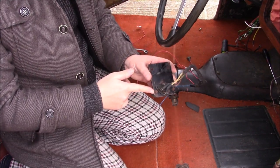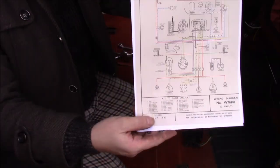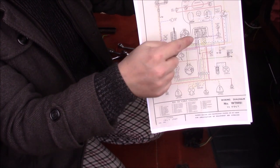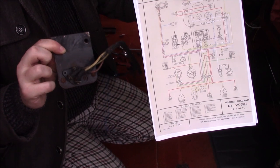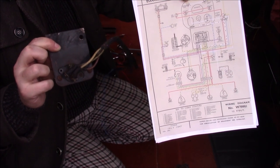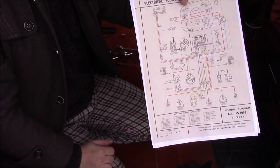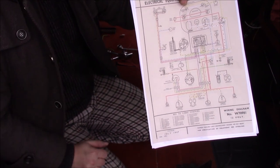To do the wiring on this piece I'm going to disconnect these one at a time. I know from the wiring diagram that it's this switch here, and the wiring colours on here do match the wiring on here — this is the original wiring and that also matches the looms, so that makes my life a lot easier. The new harness actually comes with little open spade connectors, so I don't need to worry about threading bare wires through as I have in other places.